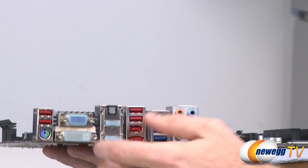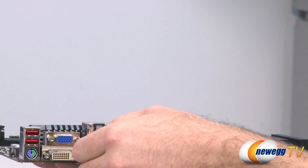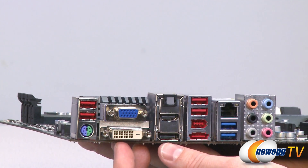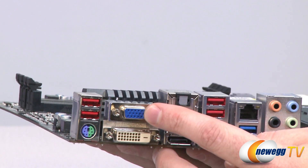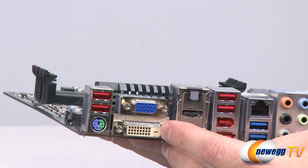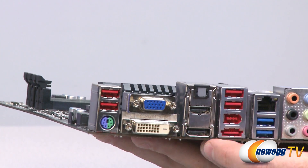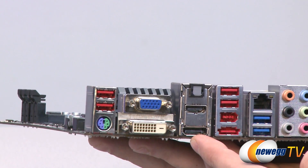Let's go back over to our video ports. These video ports are for the iGPU in your Sandy Bridge processor, so once you get your Sandy Bridge processor installed you can use these ports — you don't need a discrete graphics card, but you can add one and use the LucidLogix software to switch between them. First off on top, we have an old-school D-Sub port for those using older monitors. Below that, we have a DVI-D port supporting a max resolution of 1920x1200. Next to that, we have an HDMI out, again 1920x1200 max resolution. And finally, we have a DisplayPort out that can get you up to 2560x1600 resolution.